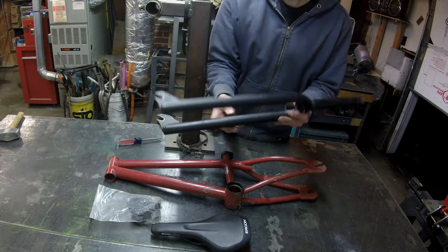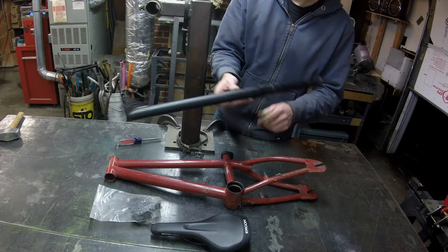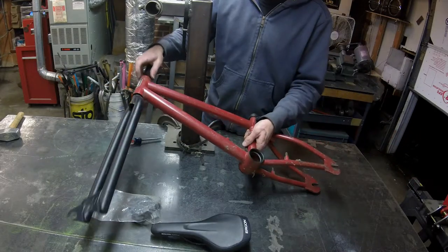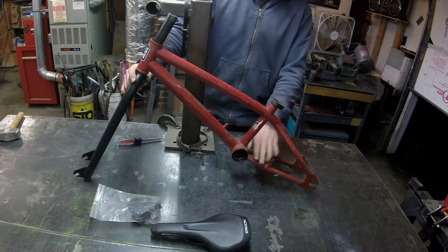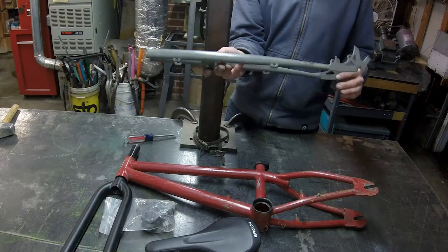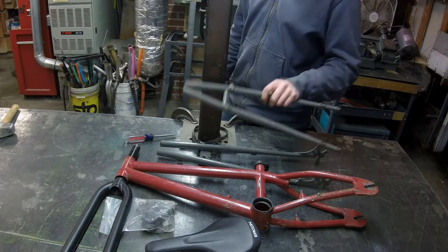The last time I did this bike, I extended the fork. This time we're using a complete 700C fork — straight tubes, solid construction, and clearance for some larger tires. I am going to replace the rear triangle on this bike. This one's bent, so I'm not too worried about cutting it off. What we do need is some chain stays and seat stays off of another donor bike. I've got these off of a long-tail cargo bike, and they're going to work great.